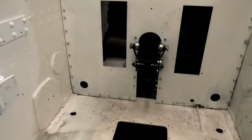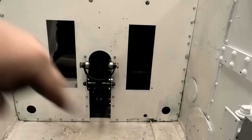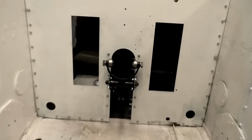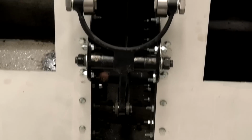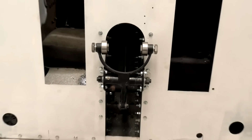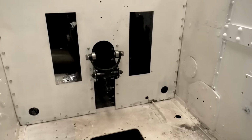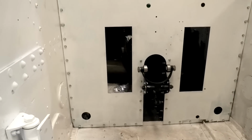Get more light in here. So those shields, they go there and there. And I've got a lot of my, this is going to zoom in, is that going to work? I got a lot of those linkage rods in there. I finally got the measurements for the short one, so I can cut that down today. But yeah, I worked it out. That the clutch fork only has 1 inch of travel. It doesn't actually go far at all. It's like on, off, that's all it is.